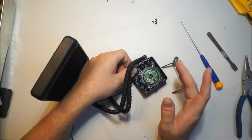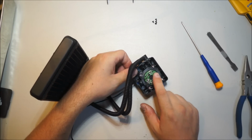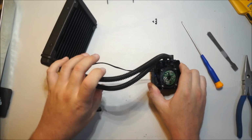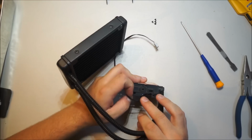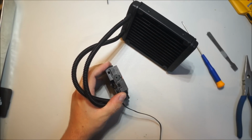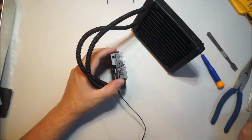So they can use open bearings, and then maybe mix some oil in with whatever the coolant is, and they're lubricated by that, and at the same time they can totally pot all of the electronics, and there are basically no seals that have to endure motion. So anyways, it does appear that this thing that I initially took to be a piezo beeper goes right into the fluid system, which means that it's presumably part of a filling mechanism of some sort. So I am going to shove something in there and presumably get whatever the coolant is all over my pants.